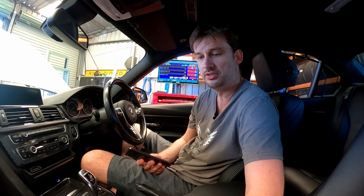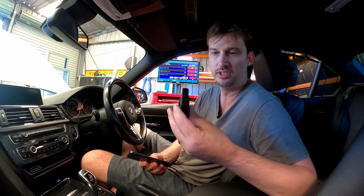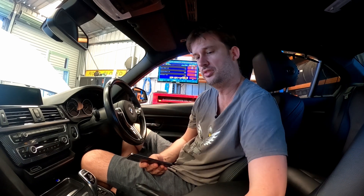One little trick is you have to know how to access both Wi-Fi and your cellular network, because you need to be able to connect to the car's Wi-Fi or e-net cable as well as connecting to the cloud so that you can update the activation license and your flash. I got a bit impatient trying to figure out how to tether with my phone — hopefully you can have some more luck. I ended up just using the e-net cable and got it all activated.